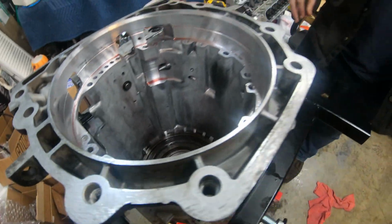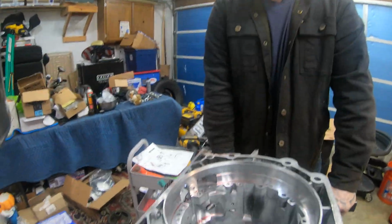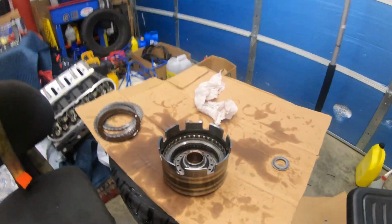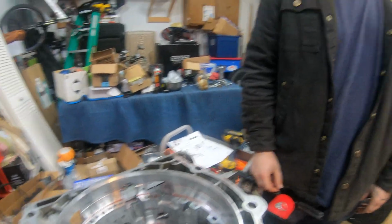Just at the bottom here, we got the input shaft in, splined, and then knocked it out with the retaining clip out, obviously. That gave us easy access to all the clutches. Everything lined up, it was perfectly fine, and then we put the new one in. There are new clutches in there too, even though we didn't intend to do them. Now we have new clutches everywhere: the whole input drum, the whole reverse clutch, and then this is the low reverse. There's clutches there. They're replaced now.